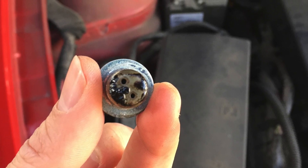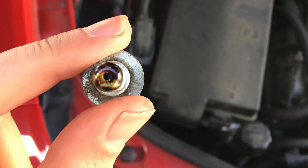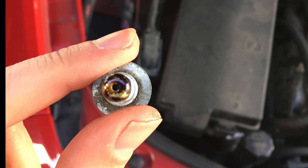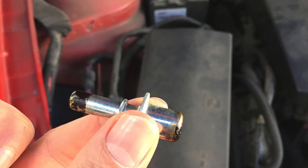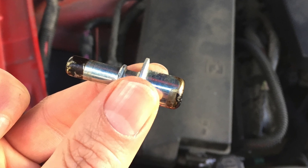As I understand it, the reason why you want to increase the size of the holes in this barb is to prevent the potential for sludge to clog these holes, causing combustion byproducts to accumulate in the crankcase. Also, GM apparently increased the size of these holes in 2014.